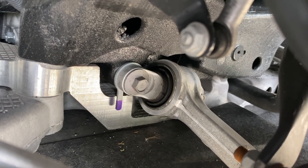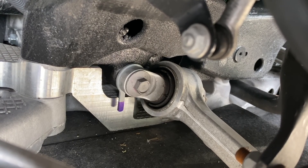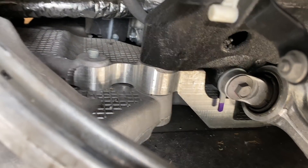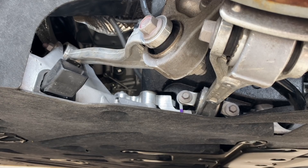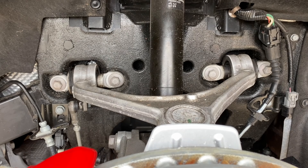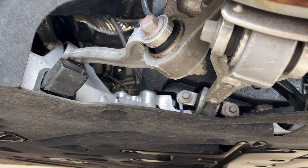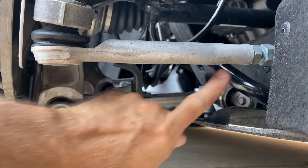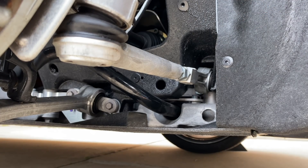Here's the rear link and how it attaches to the chassis — there's a purple-coated shim there that helps get the camber where it needs to be. It's another dog bone mount, and then there's a two-piece subframe, which is interesting. The forward link's mounting point is pretty high up in there. The two inner pivots of the lower links trend upward towards the front, and if you drew an imaginary line through those two extended forward, and did the same thing at the top — which cants down — the two would intersect. That is a hint that there's quite a bit of anti-squat in the suspension. Here's the lower lateral link and this is the toe link that keeps the wheels pointed straight ahead, with its adjuster.